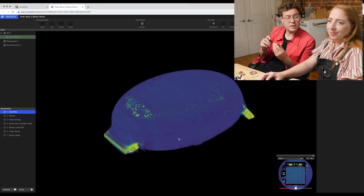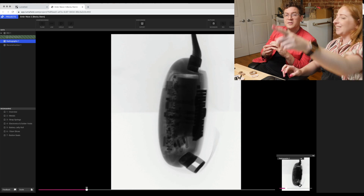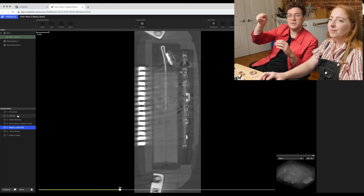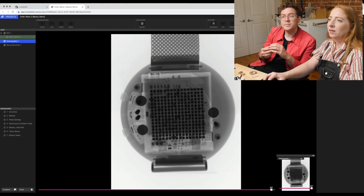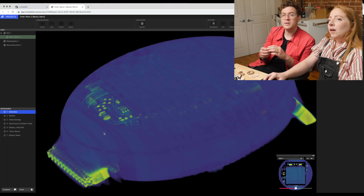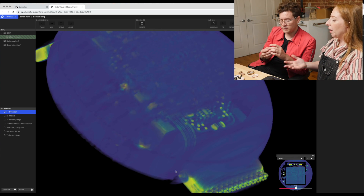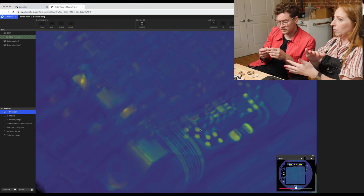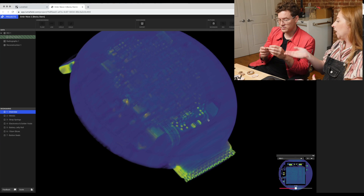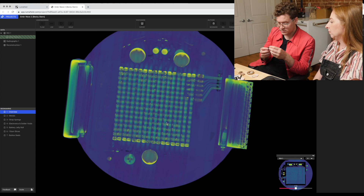In conclusion, that's what it looks like on the inside. What were your favorite parts? I liked the Peltier junction, because it looks so smooth on the outside but so blocky on the inside — it's like a little city. If you zoom in, you can see they're connected in a zigzag on the top and bottom because they're electrically in series. I like the little antenna window and seeing the chip antenna — I always like seeing antennas on the inside. It is super interesting to see the design considerations connecting the outside and the inside. When I got the device, I thought this was just an interesting design feature where it's not a complete circle, but it has a very important function: to let the RF signals in and out.